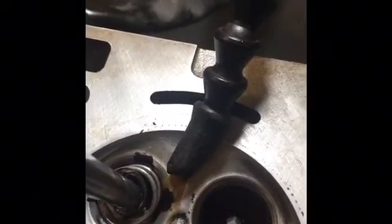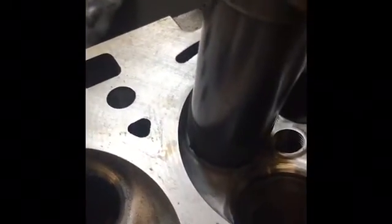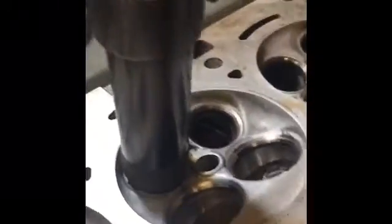Okay, we have our coolant lubricant on, painted surface. We'll grab our 45-degree grinding wheel one last time and put it on top. And we're going to make that surface a little bit wider, which makes the other two more narrow, which is okay. The 45 degree is the one that's most important, and the other two are well within specs. We'll go ahead and widen our 45 and take our measurement.